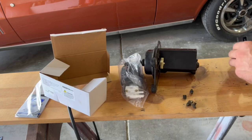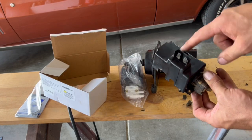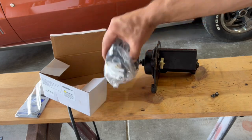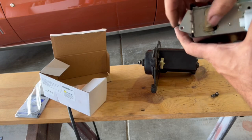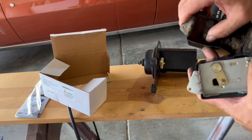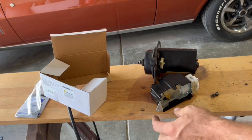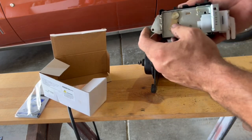Making sure that ground is clean might save you some headaches on why your wipers aren't parking when you shut off and turn the key off. The old cover I don't even need to reuse — only the two attaching bolts. Check this out — this new lever moves effortlessly. Huge difference from the old one which is completely seized. I can't get both thumbs on it to make it operate. That old one is 100% junk. The new one will work great.